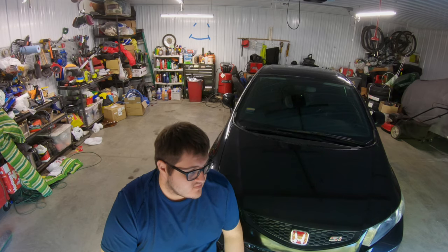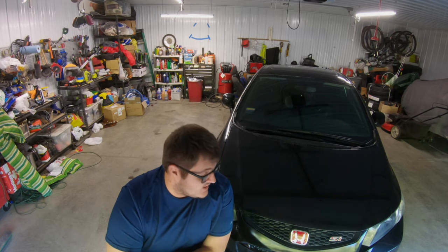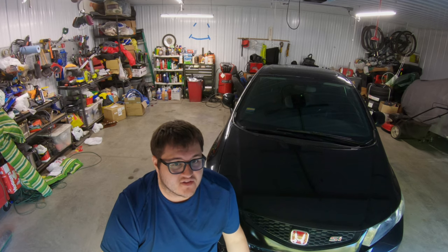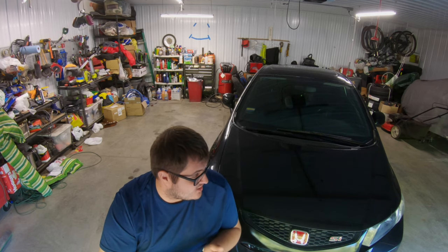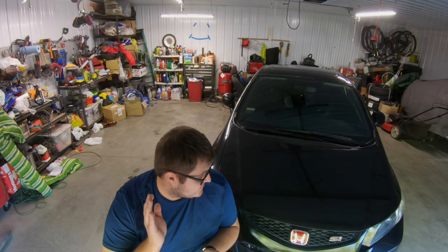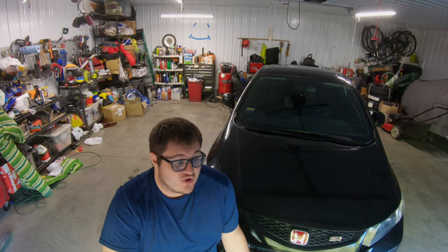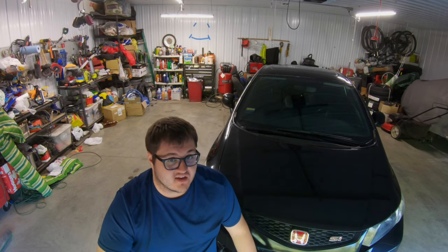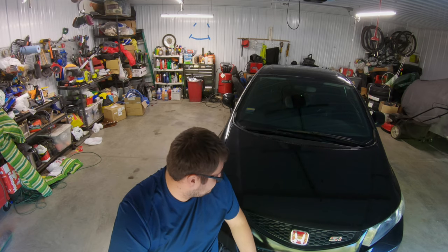The third reason the paint job didn't come out right is just my inexperience. Having never sprayed a whole car before, you can watch all the YouTube videos you want but you don't have actual experience — and that shows. I had some runs. This was my first time ever using a turbine sprayer, so I had no clue how to set it up. I ran into issues like paint hardening in the gun, pinching the hose, hose connections coming loose. Also, unlike an air compressor setup, the turbine blows hot air, so if you improperly mix it, it will flash right out of the gun, which happened to me once.